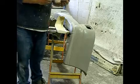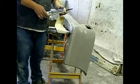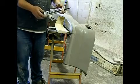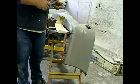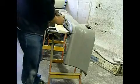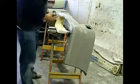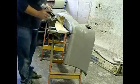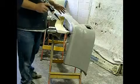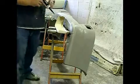What I'm using to stick these on is a polyurethane sealer, a PU sealer. Brand names of this would be Sikaflex or Tiger Seal, other things like that. Very, very good stuff. Goes sort of rubbery after, but sticks really well. I'm going to put a line of the sealer just below my pencil line, all the way down and round. Then I'm going to put a little bit inside my spat as well. I'm not too worried if this oozes out over the side, because I can trim that back afterwards. So I'm going to put some of that in, clamp it and tape it in place, and then let it bond and let it stick.